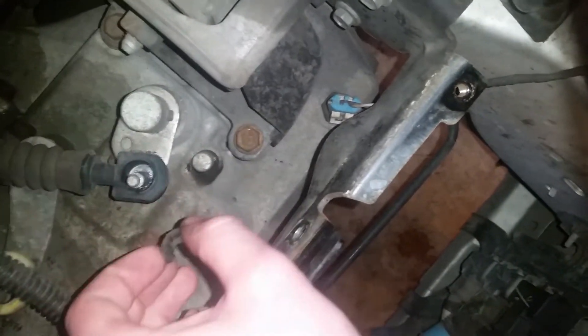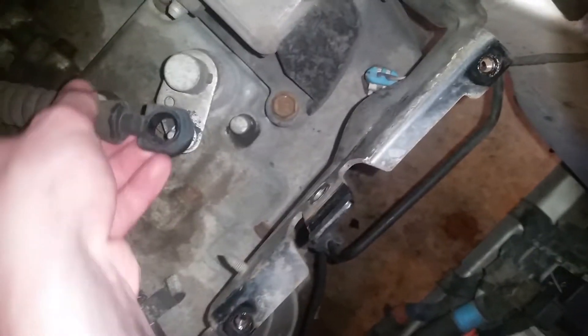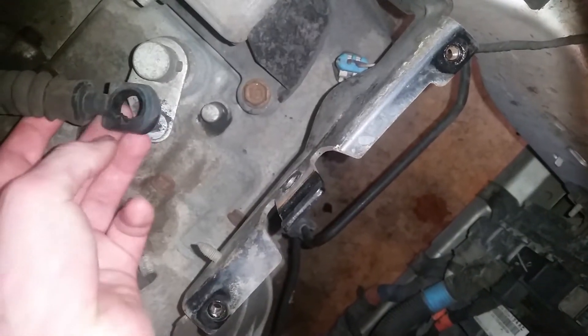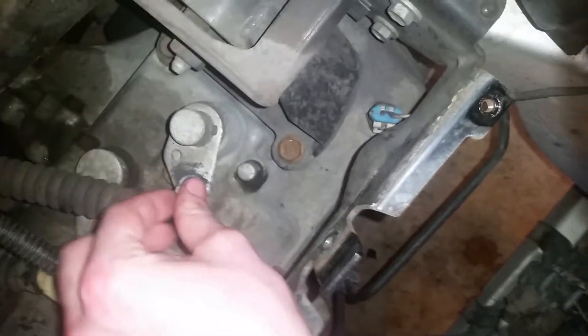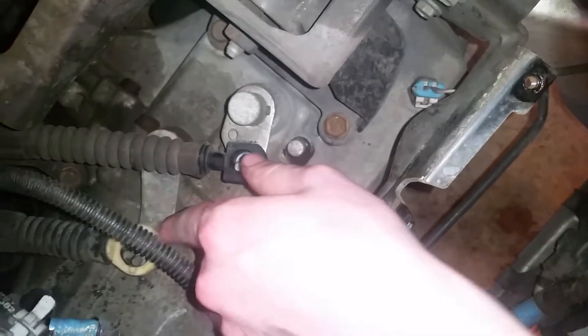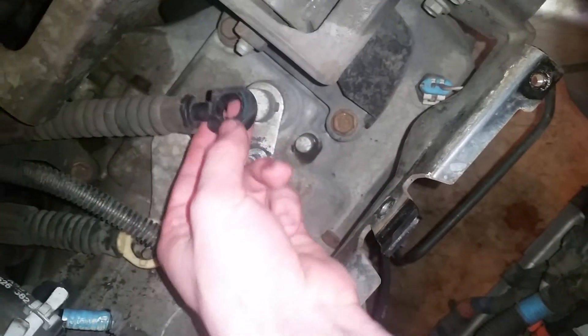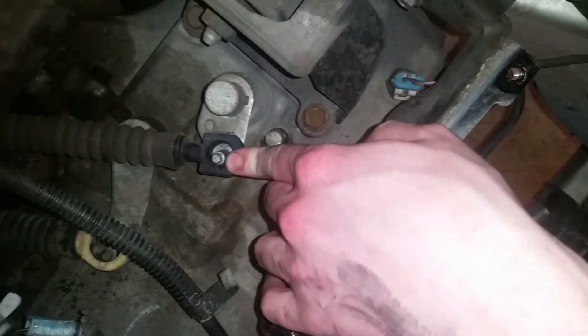This piece of ring is clearly not covering this. This guy right here should be securely fit on this bolt, because look — when the car shifts, that's what's happening. Same thing with this guy. This white piece needs to be completely filled, tight on that bolt. Same thing with this guy — needs to be really tight on the bolt.